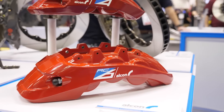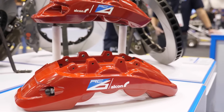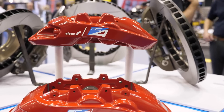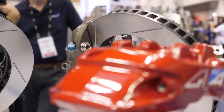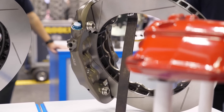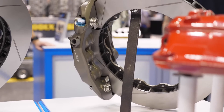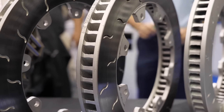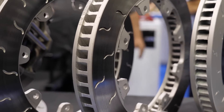Well as you say, the problems are really in the heat capacity of the system. There's not enough mass in a stock rotor to handle multiple high energy braking events. And then also the friction material itself is designed to be quiet and to work well at low temperatures, just around town, and generally it doesn't hold up to the type of abuse you'd put on a racetrack.